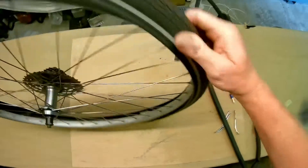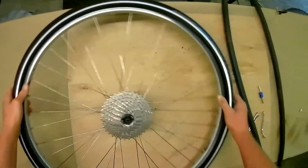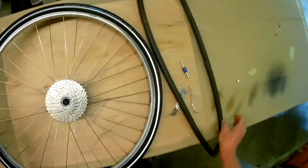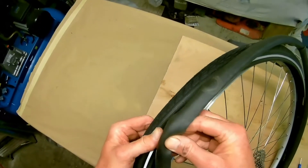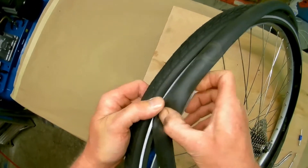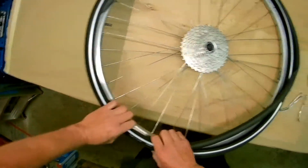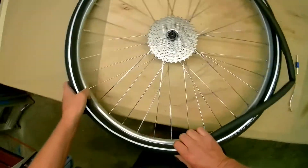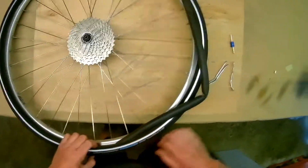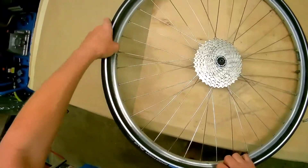We just put the outside of the tire on, which is easy. It's a few years since I put these on so I can't remember how difficult they were. I haven't warmed the tire up or anything. If you are really struggling to fit tires, it's best to put the tire in the sun so it gets more supple and expands slightly, and keep the rim in a cool place — ideally a fridge or freezer, but a 28-inch wheel won't fit in most.